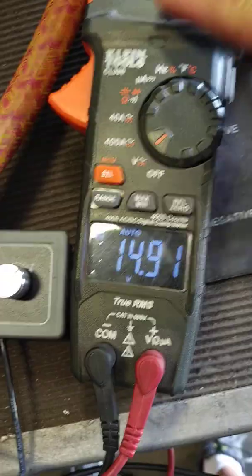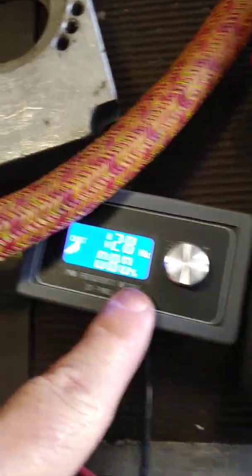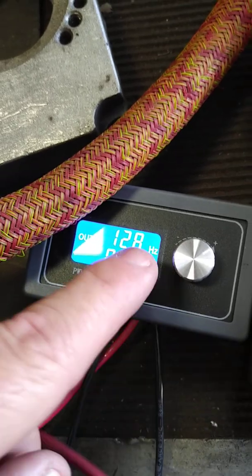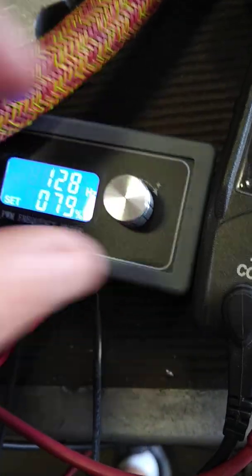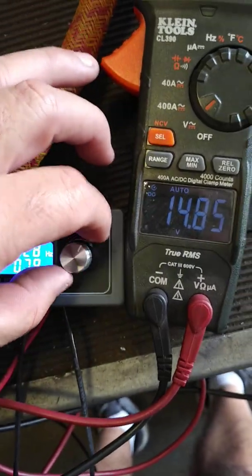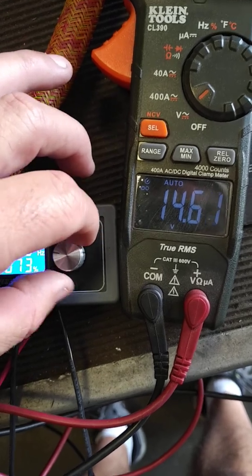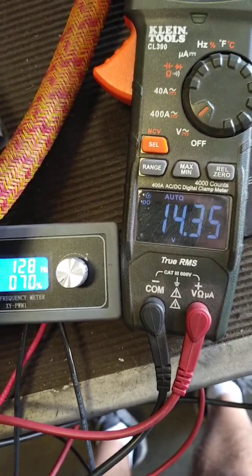You've got your voltmeter in the car and it's running. I have it at a low RPM right now. The instructions tell you to put the frequency to about 128 Hz. The percentage is what you're going to be moving — if it shows up at a different hertz, make your adjustment. Press the button and it'll tell you what you're going to move. Now, moving the percentage down to 70 percent at 128 hertz, you can see the voltage is dropping. That's the frequency telling the regulator to charge to 14.3 volts.